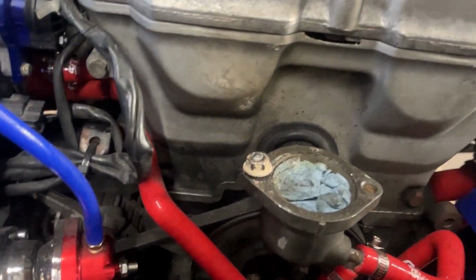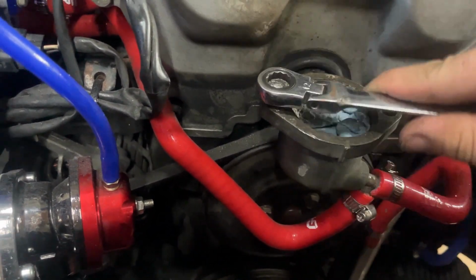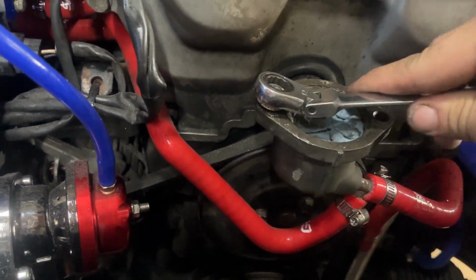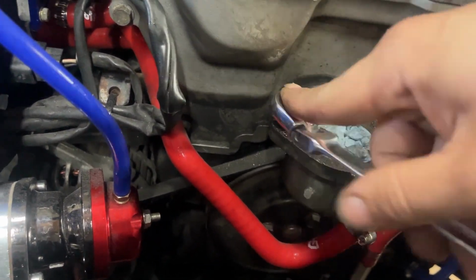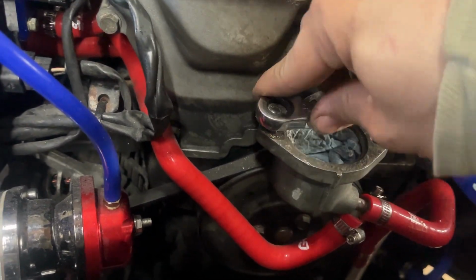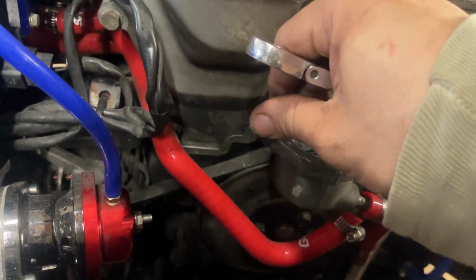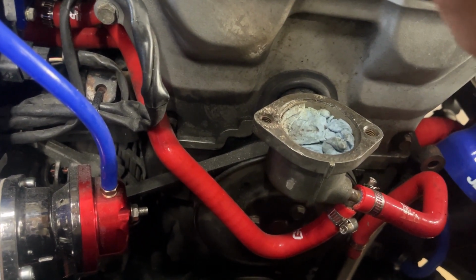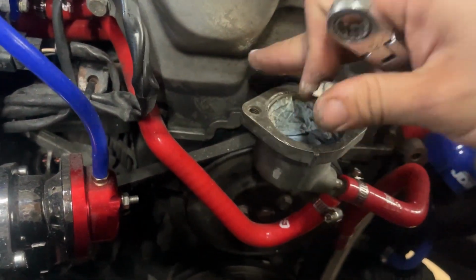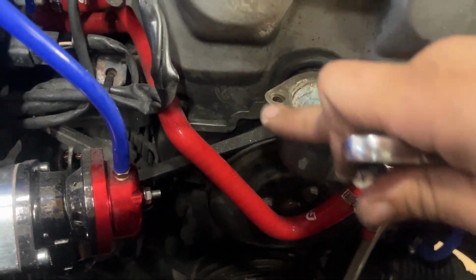I welded my last nut on there. This time I raised the wire speed and it looks like it did the trick. Yes. That took forever. Wow. Okay.